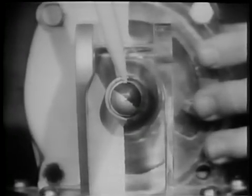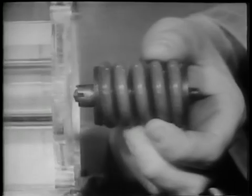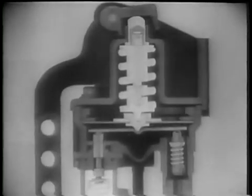The valve is operated by this plunger pushing against a pressure regulating spring assembly. This is the pressure regulating spring assembly. The spring pushes down on this airtight diaphragm. The diaphragm operates the rocker below it. This, in turn, operates two valves, the intake valve and the exhaust valve. When the brake is applied, air from the reservoir enters the intake valve. The exhaust valve permits the air to escape when the brakes are released. Let's stand it up now and look at a sketch of the action.